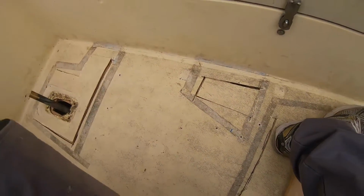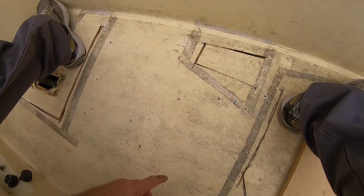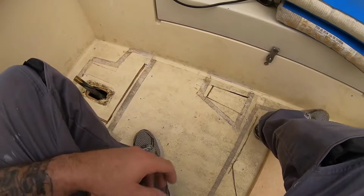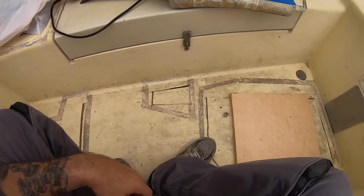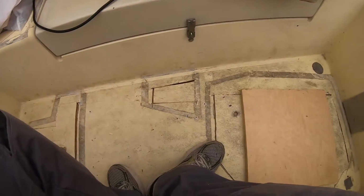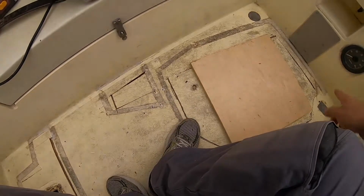And then just in case, I drilled a few more holes around just to make sure that it really was, and you can see, I don't know if you can see that or not, flaky dry wood coming up. So I do think I got the bulk of it, and it'll be sealed up, and I think when I'm done, I may just put a couple layers of fiberglass over the whole floor. I just got to make sure I maintain the drainage to the corner drains there.